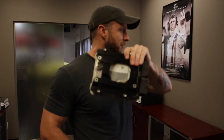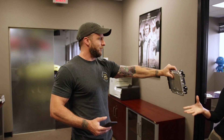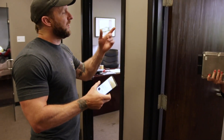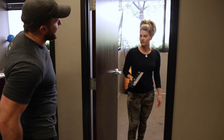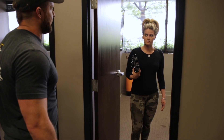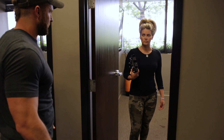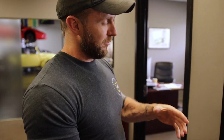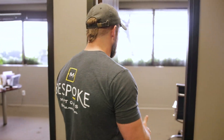This is an ECU. This ECU is going to go to Dyno Spectrum — it's going to produce more power. FedEx overnight. Put it in a box with packaging to keep it soft, but don't tape it. When you get there, ask if they have any static-free bags. If they do, put the ECU inside the static-free bag, then put it in the box and ship it. If they don't, we'll be okay.